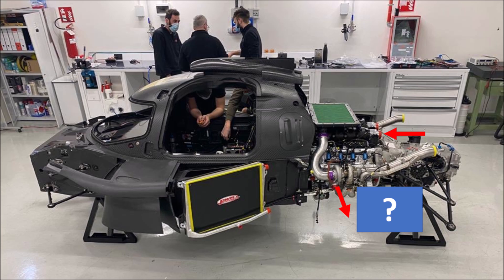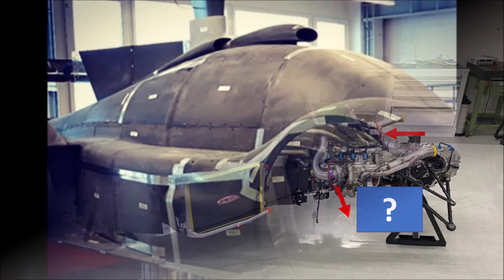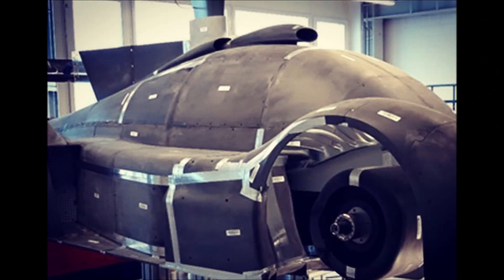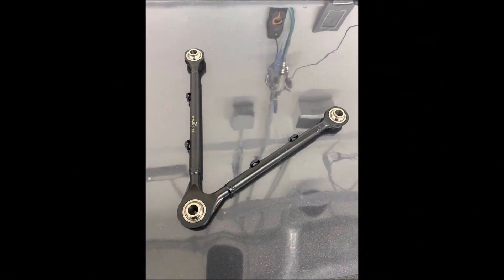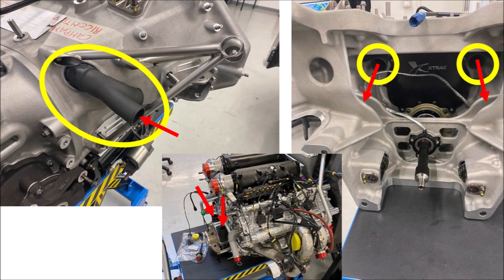One thing I'm missing is an intercooler. From the turbo outlet positions we can assume that it will sit in the side pod, but how would it get any air? I cannot imagine that they would position it behind the water radiator where hot air would hit the intercooler, and I cannot see any other air intakes. So that will be interesting to see once the assembly progresses. The wind tunnel pictures confirm the renderings but the rear wing is a bit lower in the tunnel. We can also see a large diffuser with side expansion — something that the Toyota doesn't have — and large gurney flaps to support the diffuser. If we look under the bodywork we can see the wishbones are a welded metal construction without aero profiles, and we can see a clutch cooling which I found interesting.